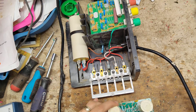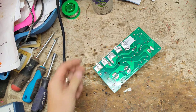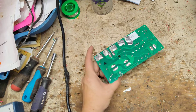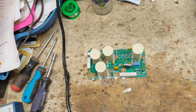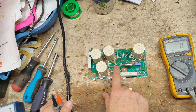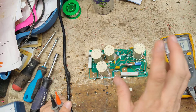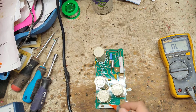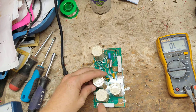The problem is in this circuit board because the little green light right here did not come on, so it's not powering up. First thing I want to check — I usually do a visual inspection. This MOV will blow sometimes; sometimes they're blue, sometimes orange or yellow like this one. I've seen them black, red, different colors. If it looks good, it is good. If it's bad, it'll be burnt black on top or the whole thing will be burnt black. This one looks good, so it is good. The next component we're checking should read zero, and it's already open — that piece is bad.